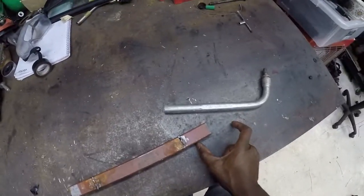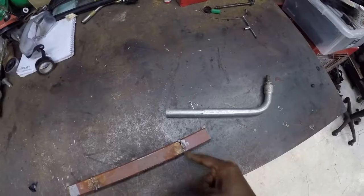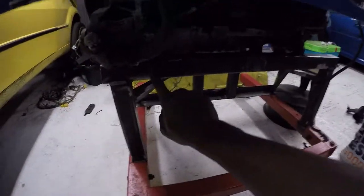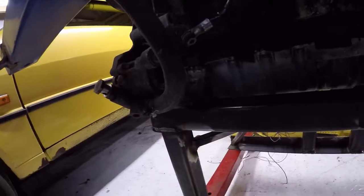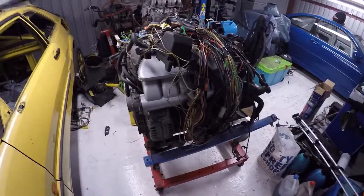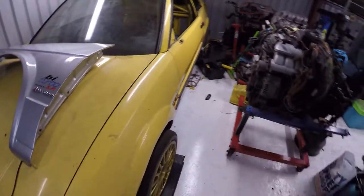So I had the whole assembly — wheel bolt, wheel brace, box section steel — and just cut it to length and welded it onto this piece of box section in three different places. There's one there, one there, and one just there. Really simple but really effective. That makes getting the engine in and out of both the Corrado and the Caddy really simple.